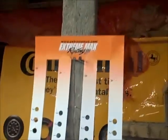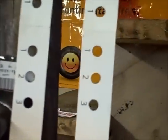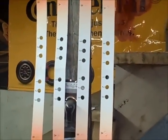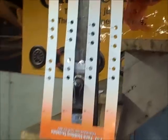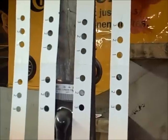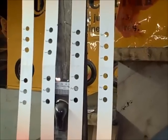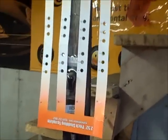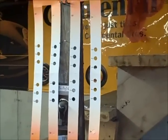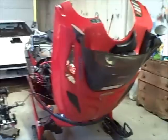How it basically works is you have a track template, and on each lug you have holes one, two, three on each side and they're staggered very slightly. You put the template over the lugs of the track, drill all the one holes out, then move it down and drill all the two holes, move it down and drill all the three holes - then it repeats itself four times on a standard track like what I have. You end up with four complete patterns that kind of move along from the inside to the outside. It's a lot of work but it's worth it.